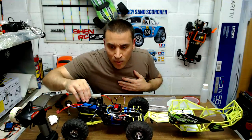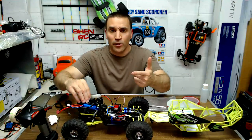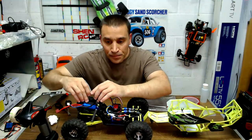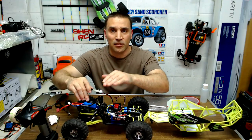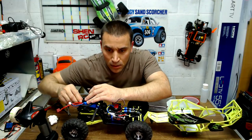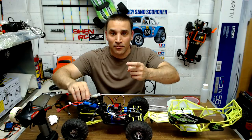Gordo RC, it's programmable with a program card. I think the crawler one is programmable. This 1060 has like three different modes. I think it has forward, no brake; forward, reverse, and with brake; and then forward, reverse, but it has a drag brake on it, because I have it in my Pajero. I think the one Omar's talking about is the next model. It has all adjustments to make it slow down how you want it to hold and everything. This just has a violent brake that holds. It works well enough on the 1060, just a little. When I'm in a mountain, I try not to put it on, only when I need to. I kind of keep the throttle a little pulled.